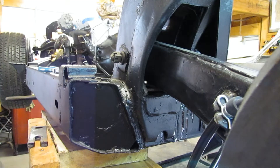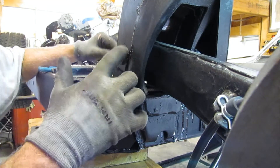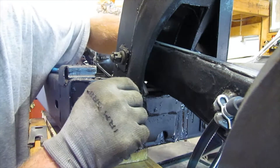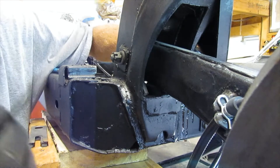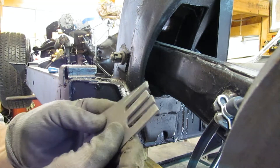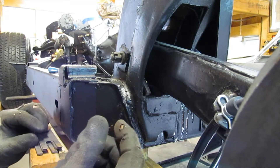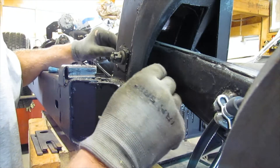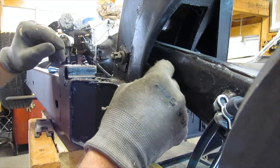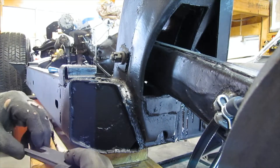The steering wheel coupler is up and down, which means the steering wheel will be straight, and I've got equal measurement on both sides. Back here at the left rear trailing arm, take your wheel off first. There's a cotter pin — take it off, loosen this nut, and you'll see a giant cotter pin, probably the biggest you've ever seen. Loosen that up from the inside and pull it out. On either side of the swing arms you'll have a bunch of shims of different thicknesses.